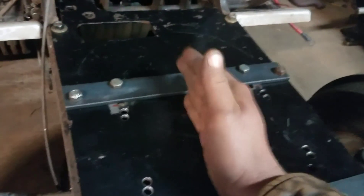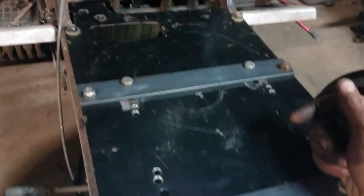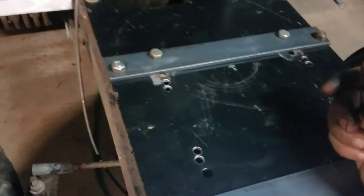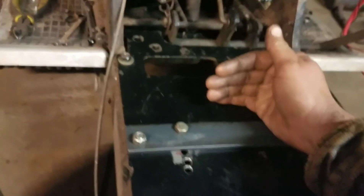So I marked where my crankshaft center line would be, but you can't see the mark on here because it had rubbed off as I was doing some work. Once you get your crankshaft center, you can measure 91 millimeters from the center to the starter side — this being the flywheel side here.